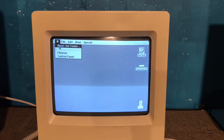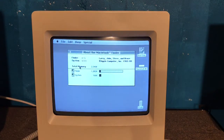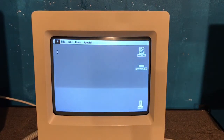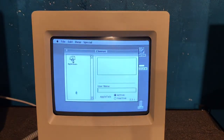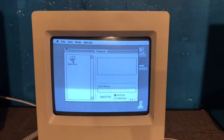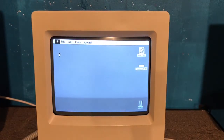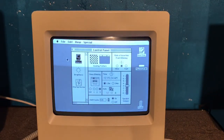However, this is still a basic version of System 6.0.3, so you are able to do things. All storage must be done on floppy disks and all your software must be loaded from disks. You only have Chooser and Control Panel. Chooser is only functional with AppleShare as there's no space for any printer drivers whatsoever, so you won't be doing any printing here. The Control Panel has minimal features — for example, you have desktop pattern, brightness, and startup disk. That's about it.